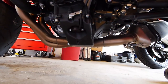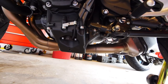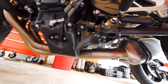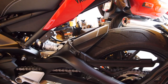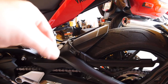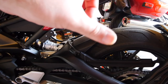Step one is getting the bike up on a stable platform — I'm going to use my rear stand. With the Yoshi R77 exhaust, I've still got the bottom of the oil pan nice and flat to jack up against. The only point to jacking up the bike or spreading the suspension is to relieve pressure on the mount bolts. If there's tension on the suspension either way, there's so much tension the bolt won't slide out. This is a very tiny adjustment — we're just getting it to the neutral point so there's no tension and we can get the bolt out.